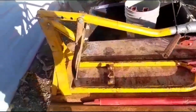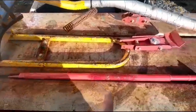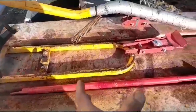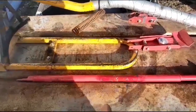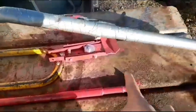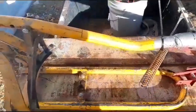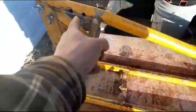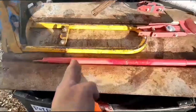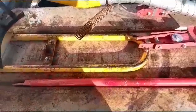So my plan now is to take my Harbor Freight tire tool that I had split in half before and added a heavy rod. But the thing is just too heavy to use. So what I'm going to do is cut off that end and cut off this end, and stick that end inside this tube about here, and then drill all these holes in here to match these holes here, make this longer, and this will be a solid piece of metal in here, and that way it shouldn't bend.